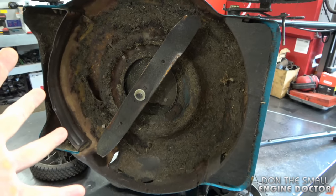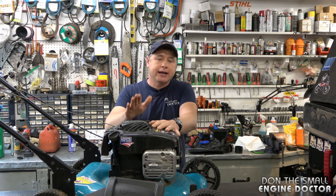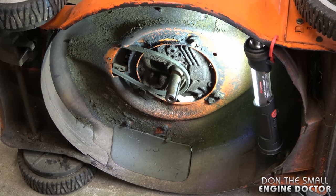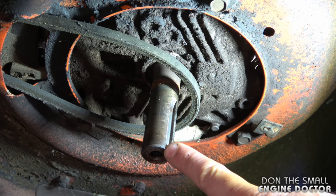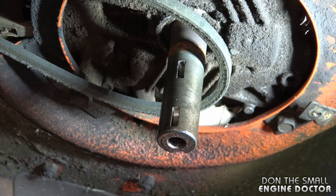The second most common reason why I see push mowers come in my shop vibrating is because of a bent crankshaft. This usually occurs when the lawnmower hits a rock or something blunt and stops immediately or abruptly, which can cause the shaft to bend. Here's a mower that came in recently — the customer hit a blunt object and it's got a bent crankshaft. I'll pull over the motor because on this one it's very noticeable. You can really see how crooked it is just by looking at it — on this one it's very clear and easy to see.